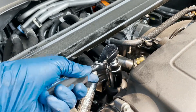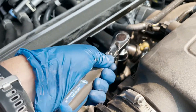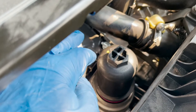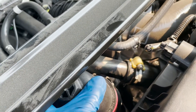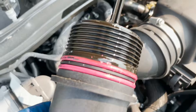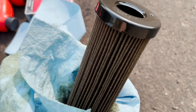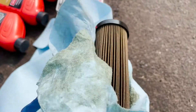The cartridge is plastic so it shouldn't be on there too tight, but mechanics sometimes overtighten it — you definitely don't want to crack it. Just be patient and work it off a little at a time. The cartridge is now out and the filter stayed behind in the housing, which is fine. I'll set the cartridge down, then pull the filter out — just wiggle it and it pulls right out. Here's your oil filter.